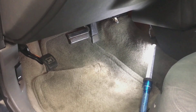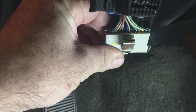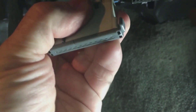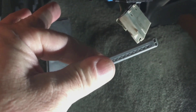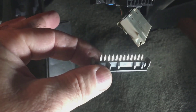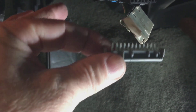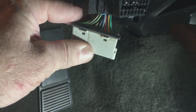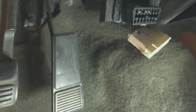The splice packs are located in different spots in different cars. This one happens to be right up by the DLC — it's this part right here — and that's the little comb that connects all of the different wires. The purple wire goes to our DLC connector; the light blue one goes to the ABS module, and so on. All it does is connect all of the wires together on one bar. So if something was grounding the circuit out and you wanted to find which circuit it was, you'd pull this out, jumper from the DLC purple wire, and one at a time go across those until you found the one causing the problem. It's a pretty neat design that GM has.